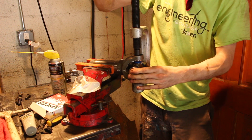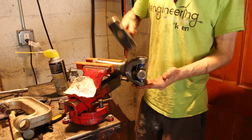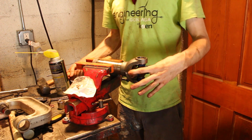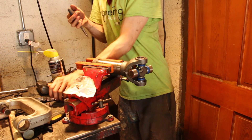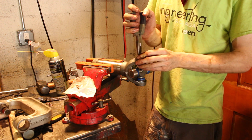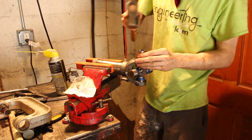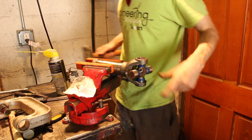That feels tight now. So this U-joint was kind of bound up, and basically I hit it with a hammer and that took care of the problem — now it's very loose and free. I'm going to install all these pieces, and then get the retainer clips in there.